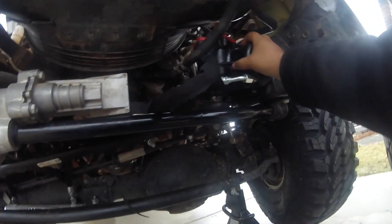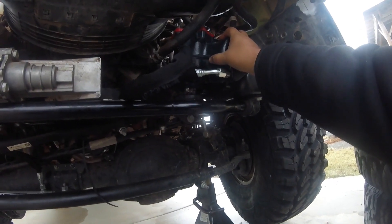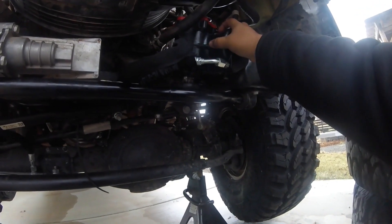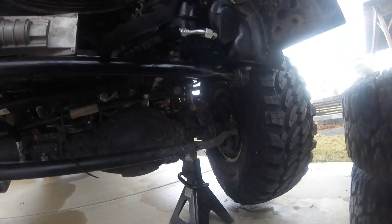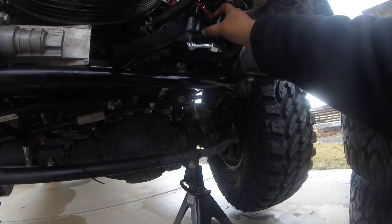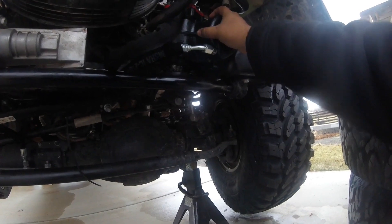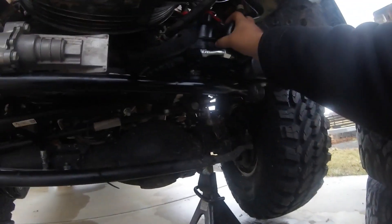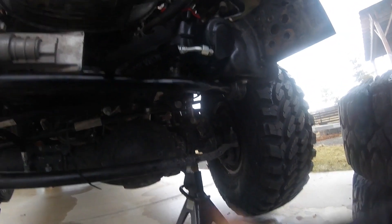Back to Redhead — it's a one-on-one match for 2012 to 2018 2500/3500. If you have a Power Wagon, you'll want to check your steering. Cycle from all the way driver's side to all the way passenger's side and find out how many rotations it does. If it's three rotations, your standard Redhead steering gearbox will work. If you have the rare Power Wagon that's four-turn steering, call Redhead directly — they can get you a custom gearbox, because there will be a difference.